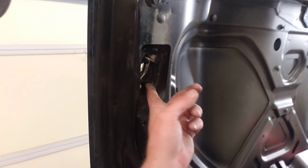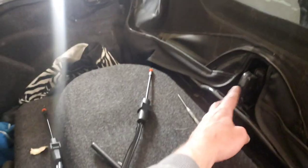I inadvertently shut the hood, assuming I could just pop it right back open through these latches. I shut the hood, looked around, and saw that the deck lid needed to be adjusted. So I went to open the trunk lid back up and it wouldn't open. Come to find out, it has a center latch right here — this is what latches the trunk, and this basically just latches the buttresses for the convertible top. That's when I figured out that these latches do not release the trunk — they just release the convertible top.